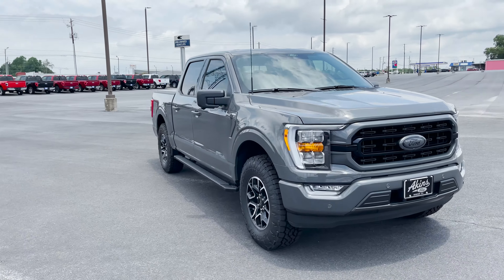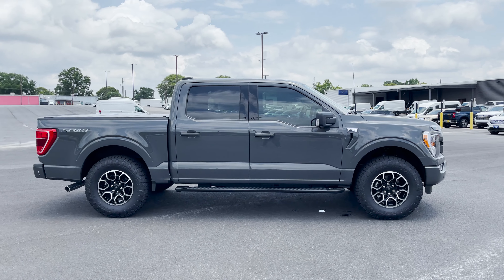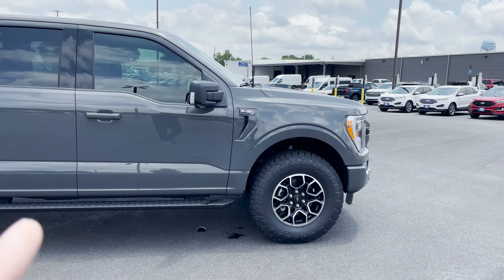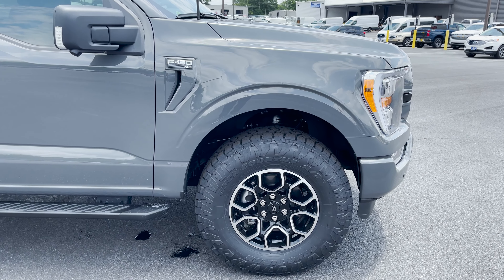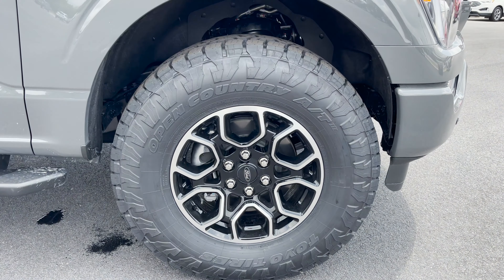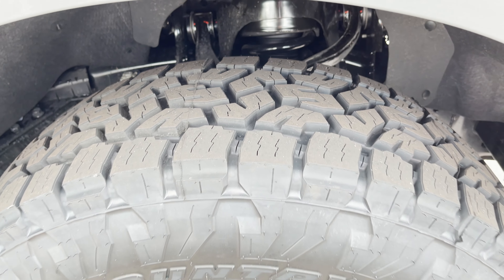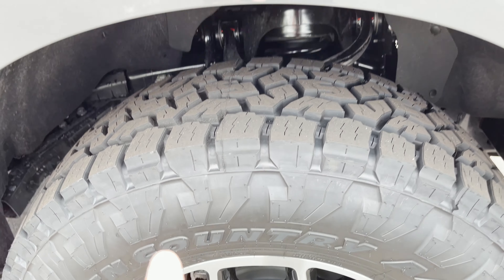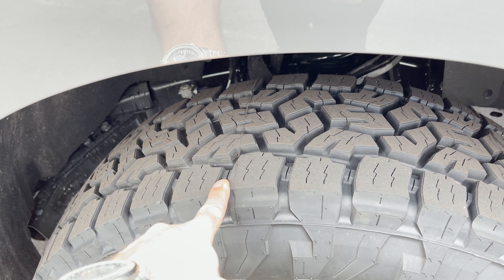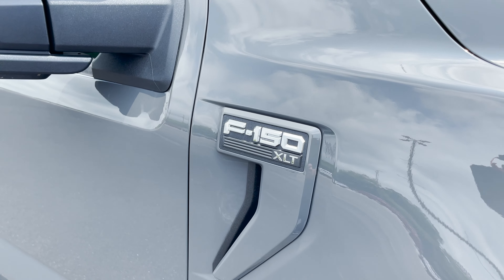Just doing that alone right there makes a huge difference. Everything else is just a great add-on in addition to. I want to show you the side shot stance — two-wheel drive truck leveled on 35s. It looks great. We're going to do this more and more because this is a great option for customers wanting to save over three grand by going two-wheel drive versus four-wheel drive, but still want that look with electronic lock and diff in the rear for good capability. All-terrain tire, 285/75/18. I love this sport wheel — looks great on 35s via Toyo Open Country AT3. Like the sidewall, it's more aggressive than the AT2, and I like that lug pattern better than the prior gen. Your shoulder lugs still have some nice off-road capability, but the center is closer together, so it's a quiet ride but a confident off-road experience, especially in the sand down in Miami.